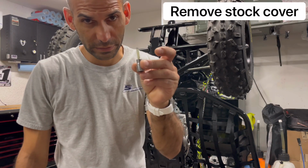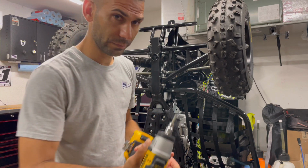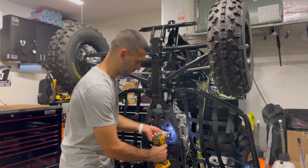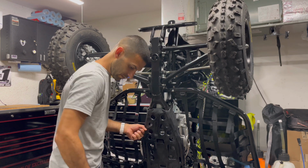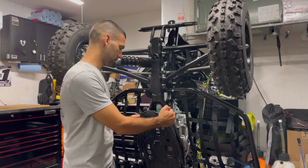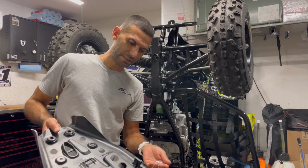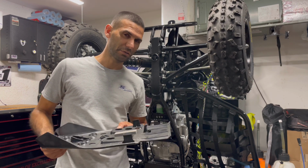First line of business, we're going to get a 5 millimeter socket with a 3/8 drive impact gun, really quick. Four bolts come off. Piece of cake. Very easy. Walk in the park. Maybe even a little too easy. Grab the leg, pull up, you're done. If you start yanking on it, it gets stuck on that hook, so you pull up and it slides off. Simple. Like I said, it's not bad, but we'll take some measurements and you'll see there are better alternatives than this.